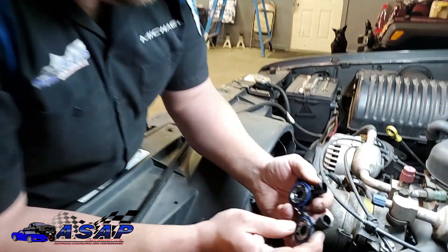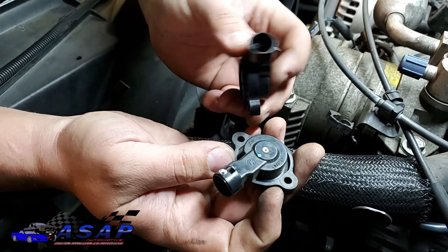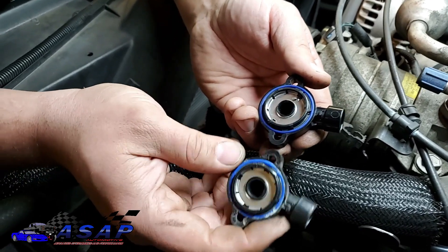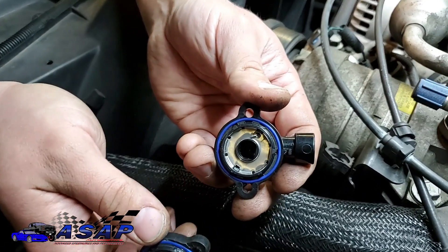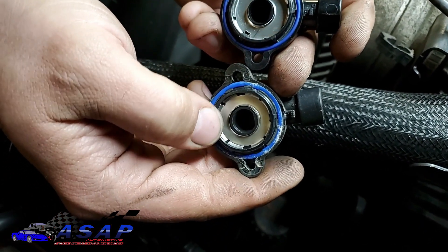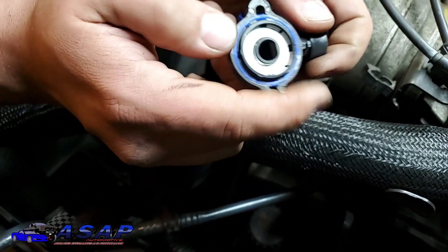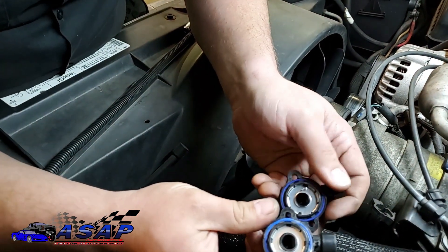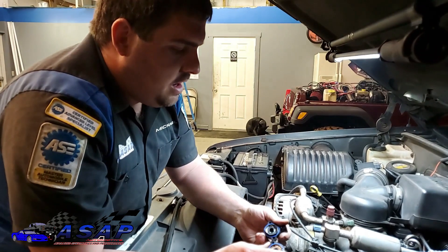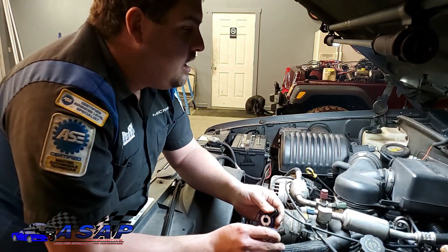You'll notice here this is actually the original sensor — it's still got some of the actual GM markings on it, the AC Delco and all. And that's actually what we're putting back on: an actual AC Delco professional series. If you look closely, notice how the new one is all nice and centered in the body. Mine is worn — see that crescent gap on that side between the metal flange and the center? That's how much that thing has worn out over time. Think of how many times that throttle is actuated over 200,000 miles. It's just going to wear out.